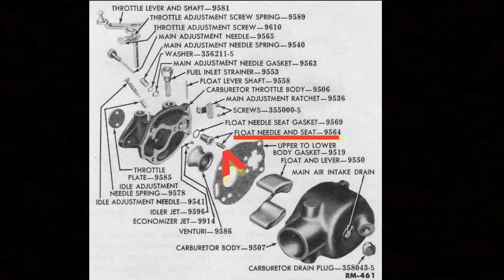I did learn a few things. When you get a brand new carburetor you may have an issue with having no fuel. Whenever these things sit for a really long time, the fuel needle can possibly get wedged up, stopping fuel flow depending on how the carburetor was sitting in storage. With that, you have to take the bowl off, pull the needle out, and usually you can just put it right back in, put the bowl back on, and it's good to go.